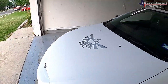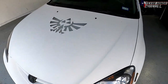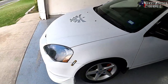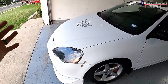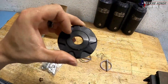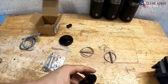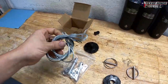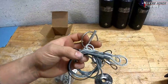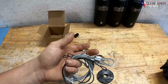I worked pretty hard on this hood to make it look really cool and light up and all that stuff. I don't want it to fail, and I did notice when I was driving that it was rattling and it was really sketching me out. So I went ahead and bought the hood pins and I'm going to install them. I do it for functionality, but I did get some good looking hood pins so it also looks aesthetically good. These are awesome because you don't have to drill four small holes to mount these — they just have double-sided adhesive which you can peel off at any time and reapply. It did come with little lanyard pieces so that way the hood pin, if it slides out for any reason or you forget to put them in, they'll still be on the lanyard.